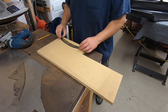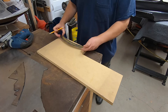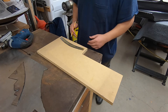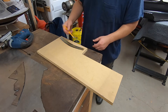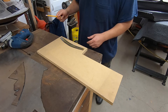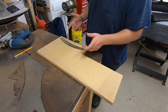Basically what we do is I'm going to trace the line here, cut out a piece that's essentially the same shape, so I can set a larger piece on here and clamp it down. Then I can take the edge that's hanging out in free space and bend it over the edge. I have two bandsaws but they're both buried, so it's easier to go with a handheld tool right now.